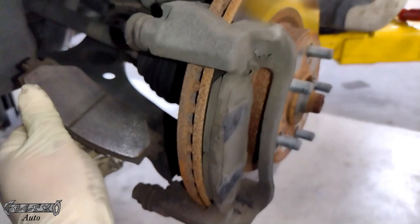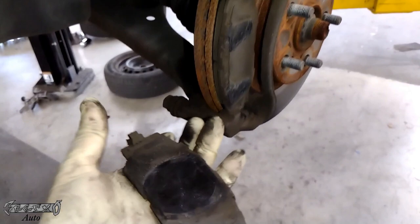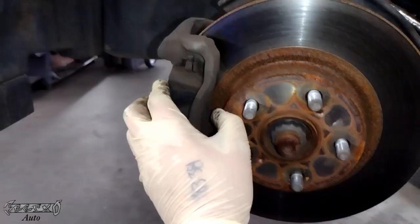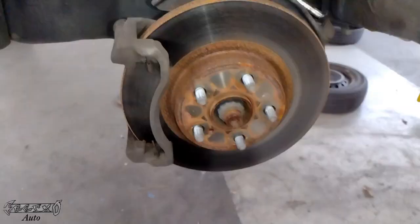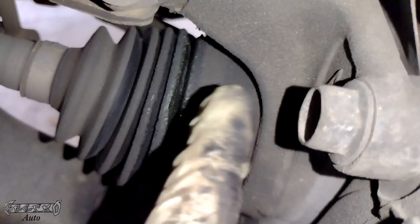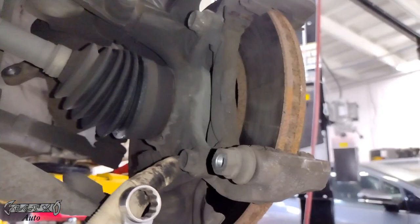Here are my brake pads - these are aftermarket brake pads that are on here. I'm going to be putting Toyota OEM ones on. Notice there's a little sensor spring on top and shims on it. If you get aftermarket pads they'll have shims on them, but I have Toyota pads so I had to buy Toyota shims separately. Notice these springs are on top, and the reason is for going in reverse - I'll show you in a little bit.